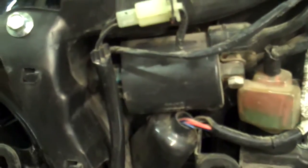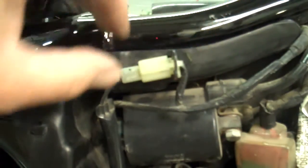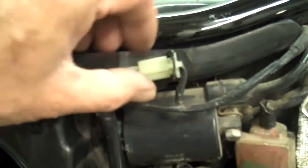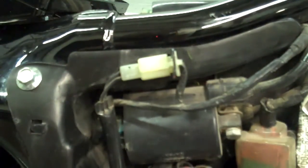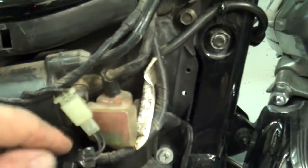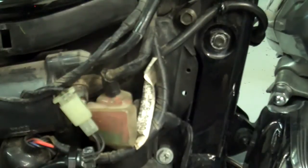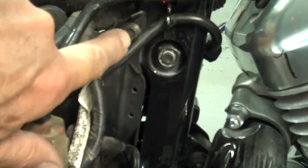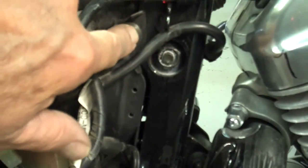First thing you want to do is snip this little tab off here and relocate this little clip down below. Go ahead and snip that little tab, take it off, and move it. I've gone ahead and wire-tied this little connector down here on this wire just to get it out of the way and have it fit flush in there. Then the next thing we want to do is remove this screw right here — the little black one that holds this plastic side cover on.